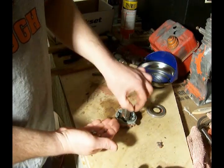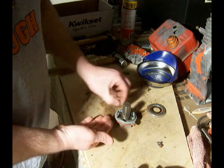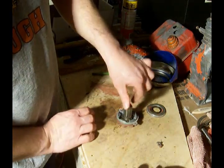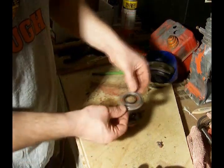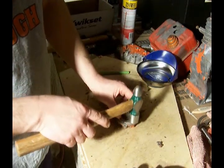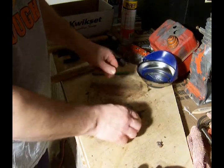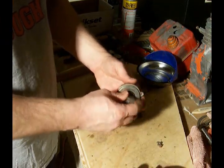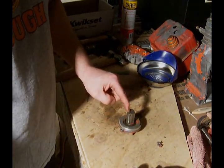Put that in place. It will lock that way but release that way. Take this piece here, slide it back on top, get your hammer, and gently tap it together. Get it back together — turn it that way, but it grabs hold that way. Alright, there you go — one starter clutch for a Briggs and Stratton 5 horsepower engine.